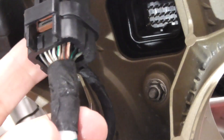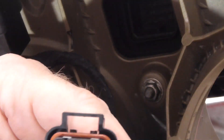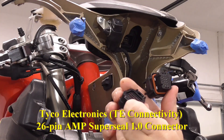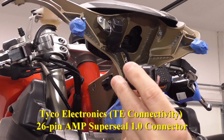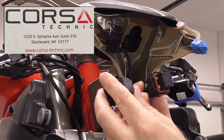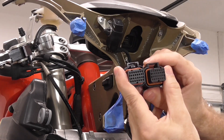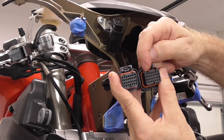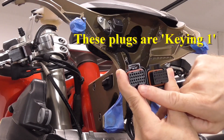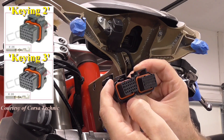We actually have 26 different wires going into this, so this is going to be a challenge. This really is a one-off project — I've never tackled anything like this before. I did a little research and found out it is an AMP connector. I ended up finding this connector over at a site called Corsa Technic and they were very helpful. They instructed me to compare and take note of these locking channels — there are two on the top and one on the bottom — and everything matches up exactly, including the same number of pin holes.